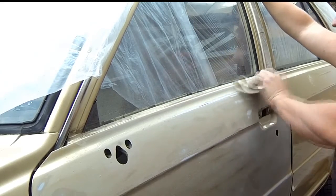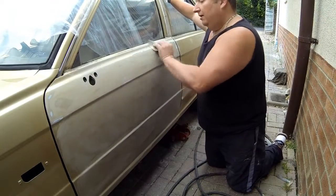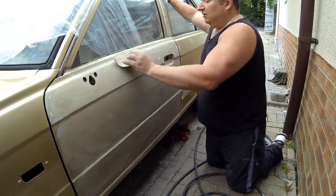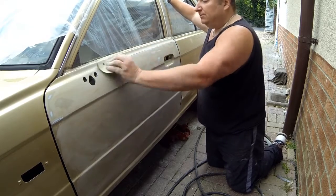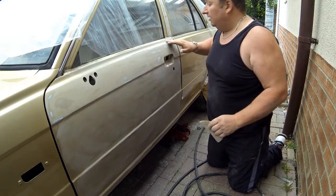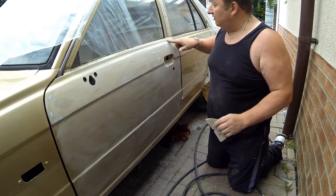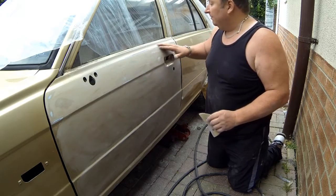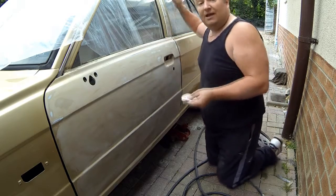So that's what I'm doing here. When you run your hand over the panel in question, you basically don't want to feel anything. I need smooth transitions between stuff from underneath to the top. Here, for example, I can still feel a difference between the base smoothness and the lacquer, so that's obviously got to be sanded more.